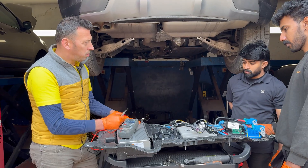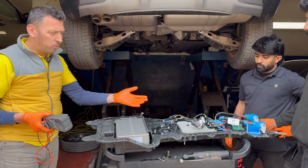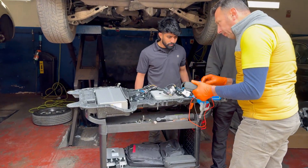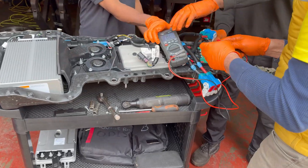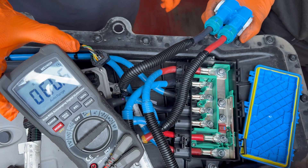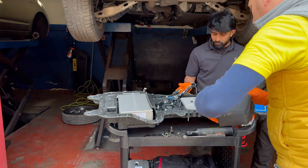On the Audi, if the alternator stops charging, this battery gets discharged, and until we charge the 48-volt battery separately, we can't get the alternator charging again. So let's hope that's not going to be the case here — we have no related errors. We're going to check a few things. The fuse is good, the resistance is fine, so let's just replace the control unit and do our job.